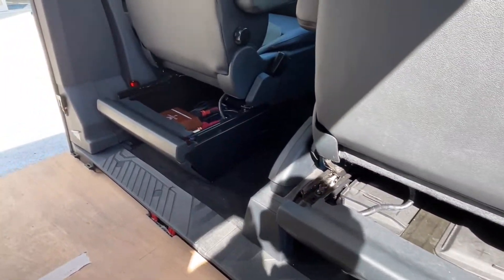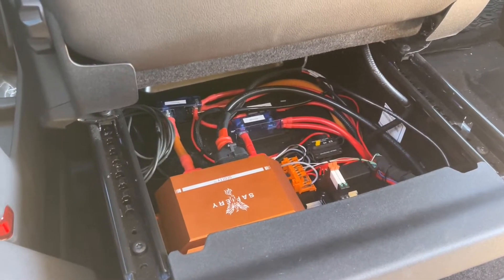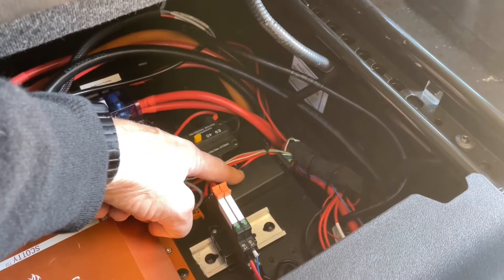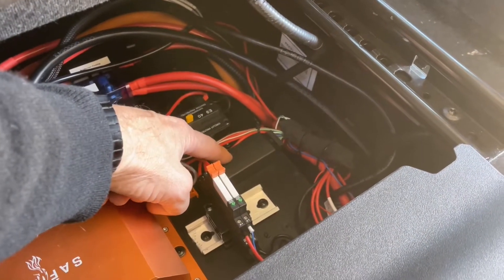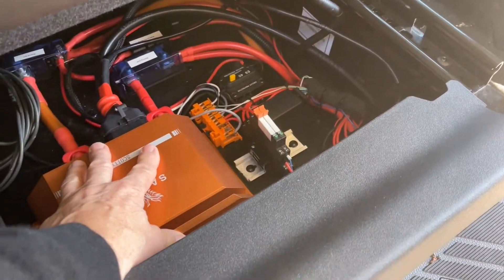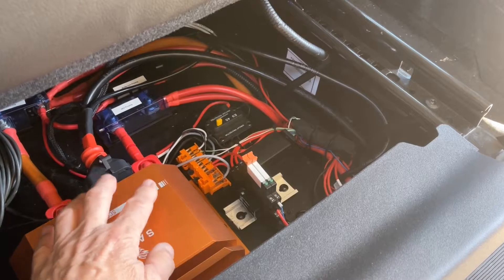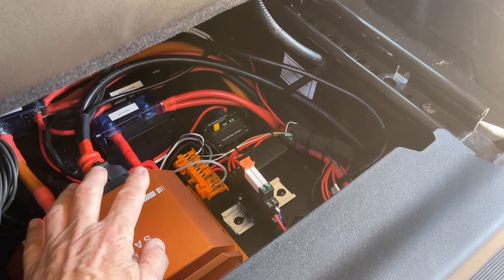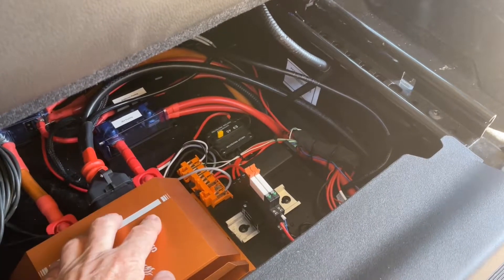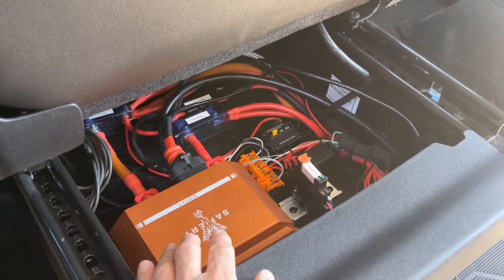What we've done on our Scotty DC to DC is add this little black device which reads the CAN bus of the vehicle. When the vehicle is under 1000 RPM — which we program into it — it turns Scotty off. Scotty will come on after 1000 RPM, which means it will be fully compliant with the Euro 6.2 standard. We can even program it based on engine load, but we're doing this first test on 1000 RPM.